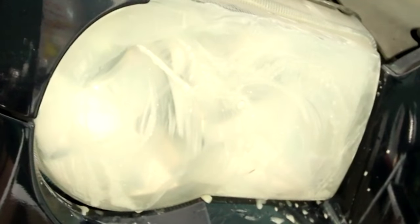As you can see here, I'm starting out with 1000 grit wet sandpaper with a bucket full of water that I used to wet the sandpaper. I'm going in circular motions and you want to go over the headlight equally. The goal is to get the entire headlight to have the same consistency of sanded surface. After I buff it off, the headlight is equally faded all the way across — that means you're ready to go up to the next grade of sandpaper.